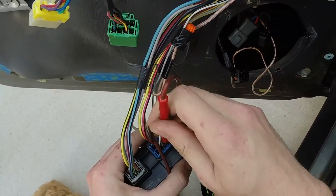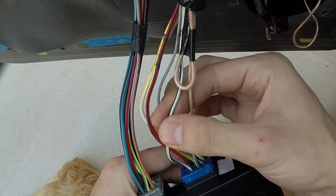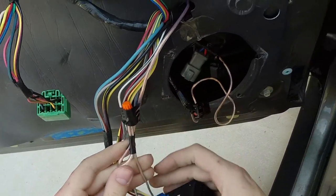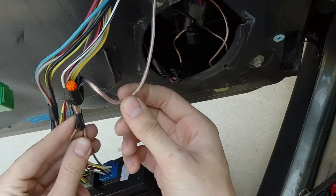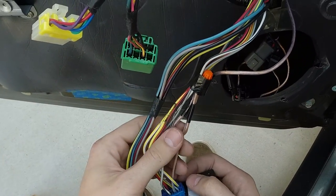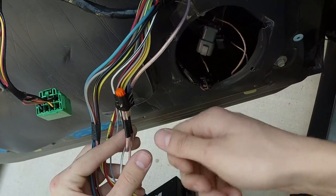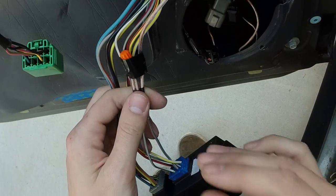Since we tested and found that this wire is my down button — the one I need, since my up one with the black and white always has a good connection — I'm going to take this one, follow it up, undo the bundle of tape down here for more room, and cut it in half. Then get another piece of wire — I use 16 gauge, the bigger the better, 14 gauge works too. You're going to twist off both ends, twist off the new wire end, wire all three together, put a wire nut on it, solder it — however you feel most comfortable.